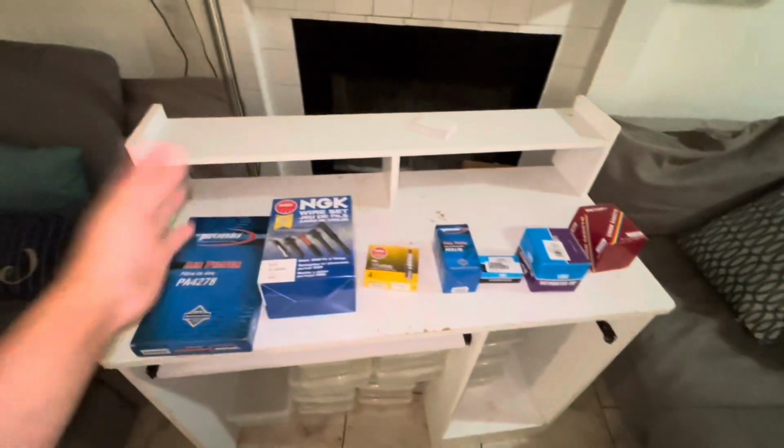I feel a little bit better from my wisdom teeth extraction surgery, so we're gonna work on the 240. I am currently dealing with idle issues on the 240 after getting it started. We couldn't get it to pretty much stabilize, and then whenever you try to accelerate, it will just die. So I went ahead and bought some things on eBay or any other website.